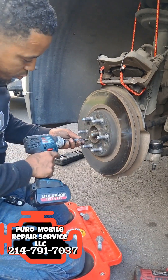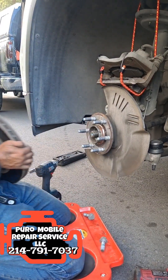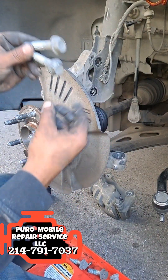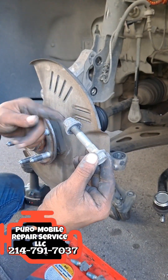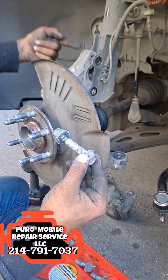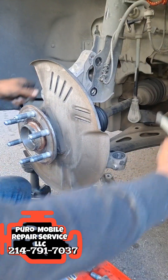It's proven to be pretty durable and gets the job done real easy. The last steps here — you're going to want to take off this bolt and this bolt. These bolts go in this way. On one side of the bolt it's like this, which would be the 18 millimeter side. You'll get it off on this side, then put it back on slightly just so you can hammer it back out. The importance of that is you see these ridges — they kind of bite in, so you'll have to hammer them out that way.